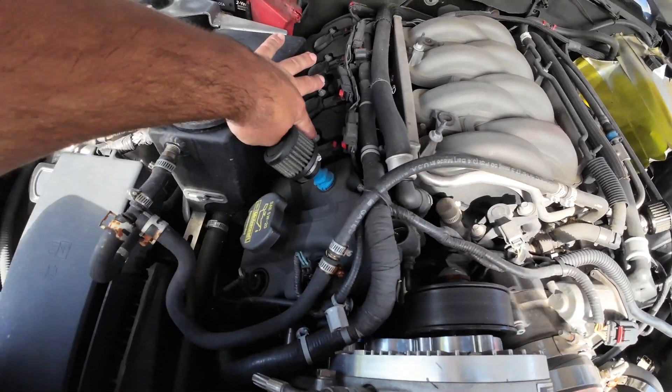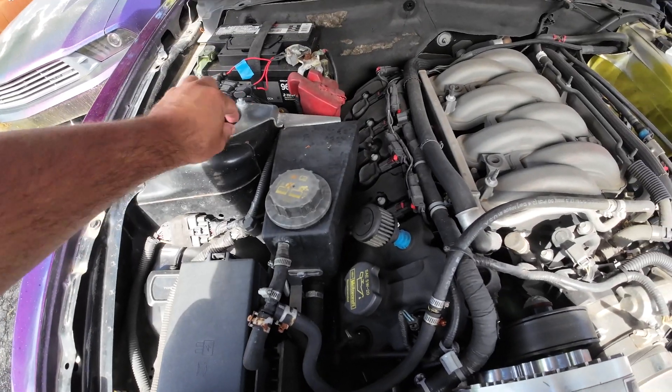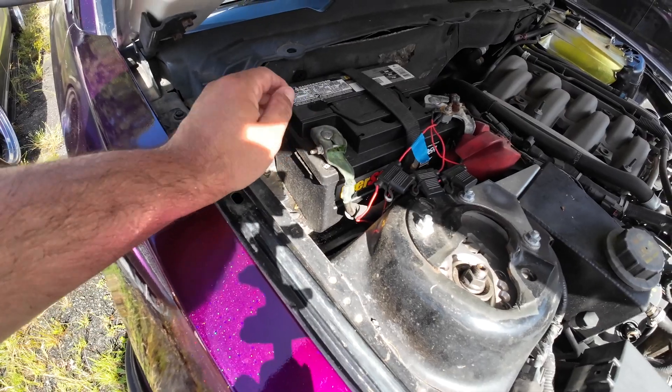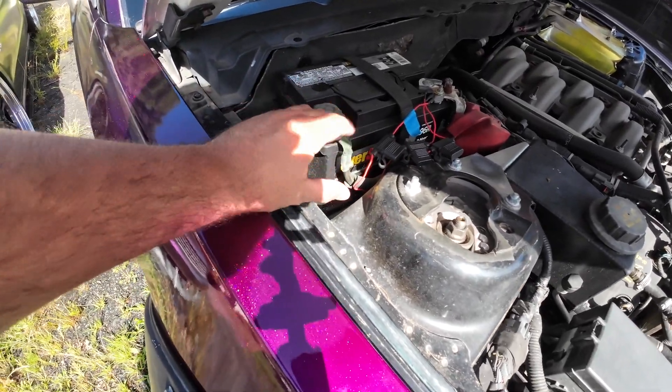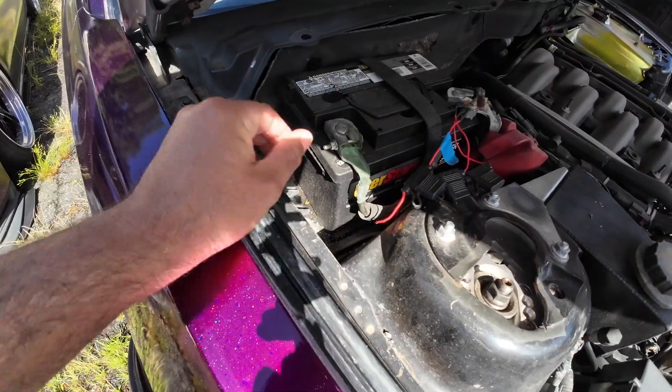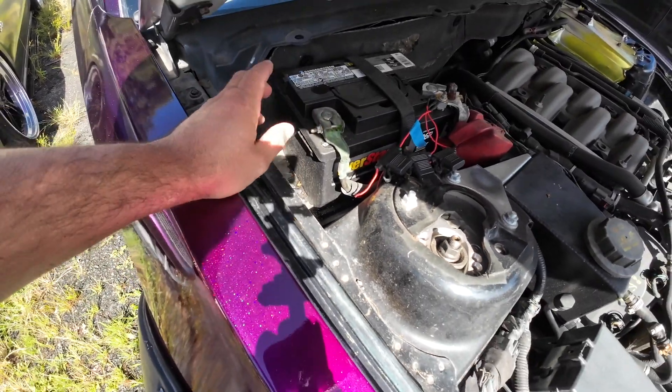This should be an 8 or a 10 — I think these were 13. Before you do anything, make sure you disconnect the battery, just for safety. You don't want to drop anything across that constantly hot terminal and blow fuses and stuff. If you're doing anything to your car, just disconnect the negative real quick.